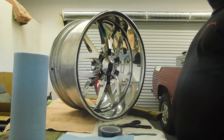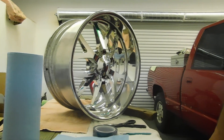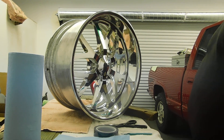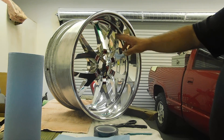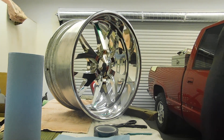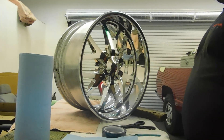Usually I like to unmask them as soon as they come out of the oven and they're cooled off enough. If it's an option for you to be there when they do them, I would do it that way. If not, I would ask them if they could unmask them for you carefully and try not to scratch the wheels. Being polished billet aluminum, it's really easy to scratch with a fingernail — or forbid they try using a razor blade to take the tape off and damage your wheels.